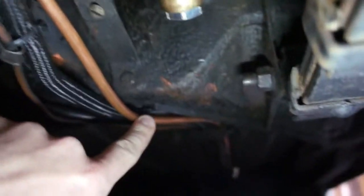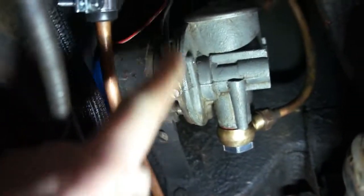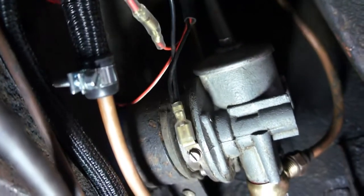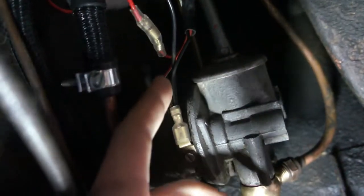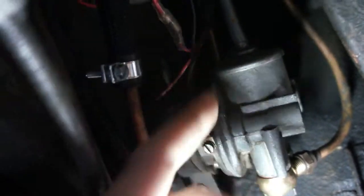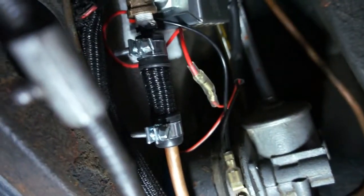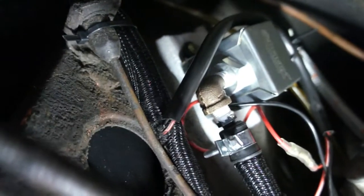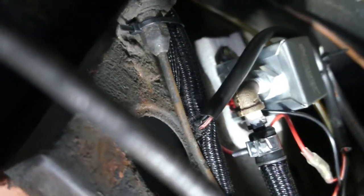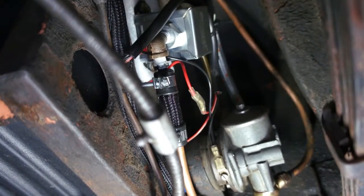Now there's just this small flexible hose going out from the electric pump and then down through the copper line all the way down the vehicle. The negative is attached here with two wires — one goes to the negative from the vehicle and the second passes that negative on to the new electric pump. The positive comes in through the new covering, out of this small hole, and then up to the two pumps. It's all pretty clean, looks good, and it works.